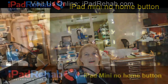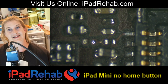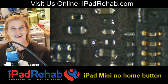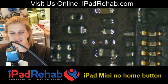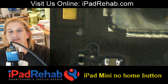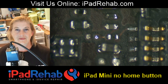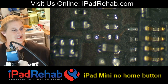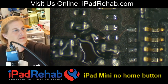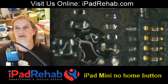We're definitely not going to have home button function if filter L1760 in that line is just missing. One solution would be to leave your iPad open and carry tweezers - anytime you wanted to activate the home button, you'd just touch the home button pad to ground. But that's not convenient, especially if you're giving it to your kid for school. So we're going to get this fixed. Let's warm up these pads and do this quickly and painlessly with the mini hot tweezers.